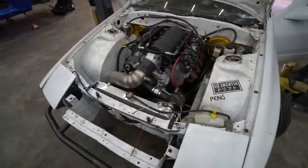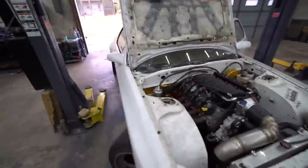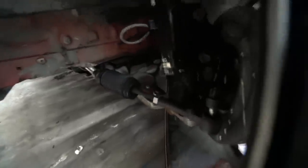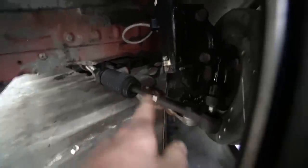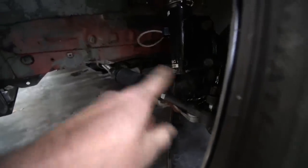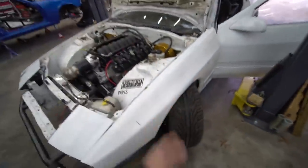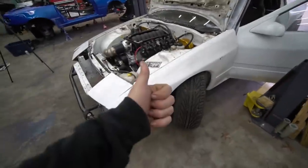Now I'm in a food coma, but we're going to get some more work done. I want to back this thing out of here and try to get the wheels turned fully. In the air I could get the tire to hit the control arm, but I can't muscle the wheel enough to turn it any further than this without the car moving. So we can go outside and use the load of the car turning to get the wheel to go to full angle, see if we're still hitting on the control arm with the car on the ground.